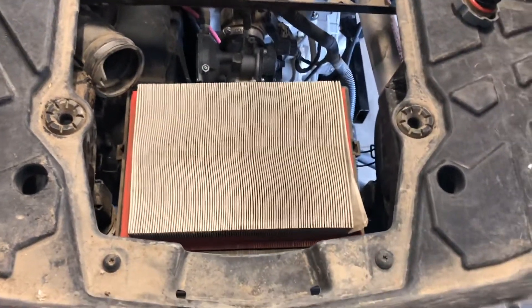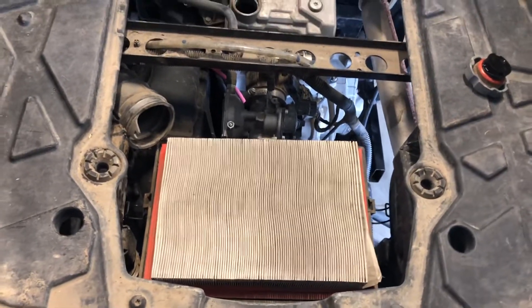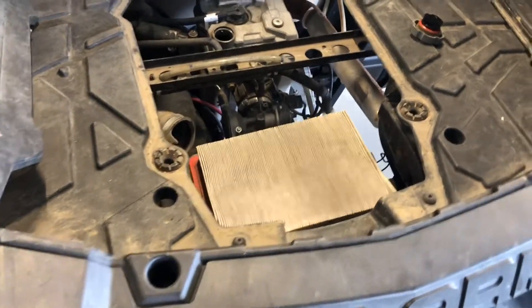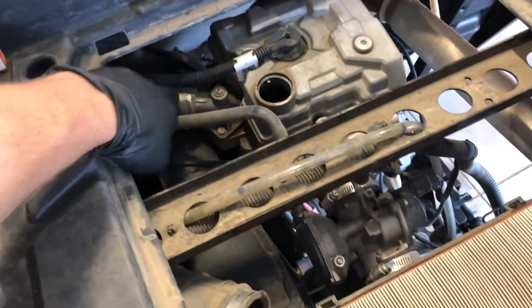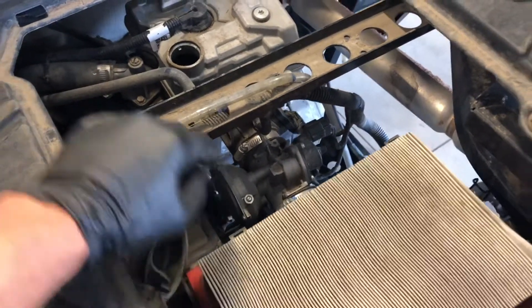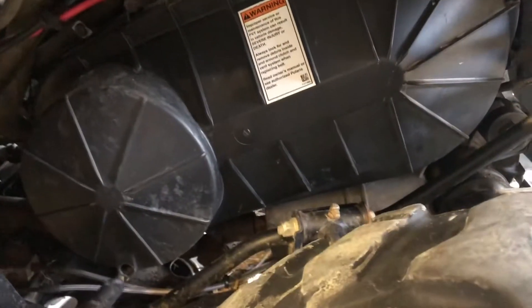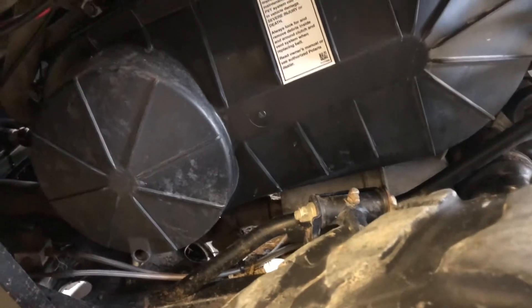You never want to run it dirty. This one is getting replaced — it's too dirty, and you start burning engine oil when you keep it that dirty. That's your coolant line running in here with the thermostat, and your throttle body is here as well. On the left-hand side, you've got your belt cover with a drain plug for the belt. If you ever get water in there, pull that drain plug and make sure it flows out.